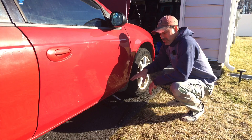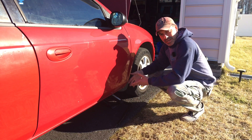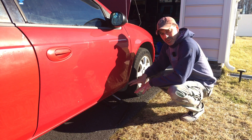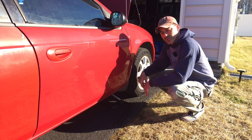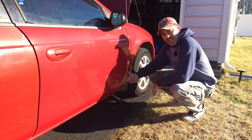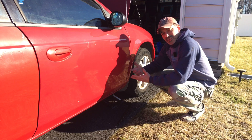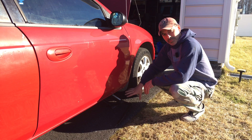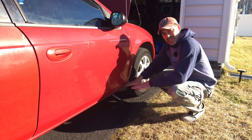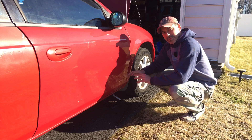It's easier if you can get the front elevated a little bit. I like to use a jack because you don't want to drive it up on ramps — you'd need to level it back down while draining the oil. You don't want to run the car empty with no oil in it, so I jack the front end up, remove the drain plug, get the filter off, then lower it flat to let everything drain out, and raise it back up to put everything back in place.